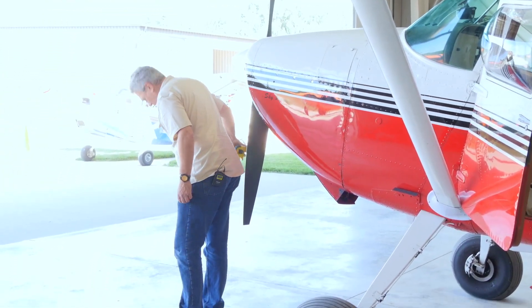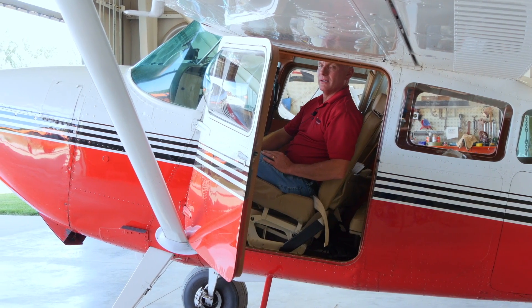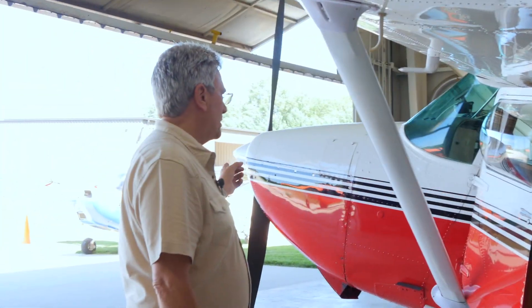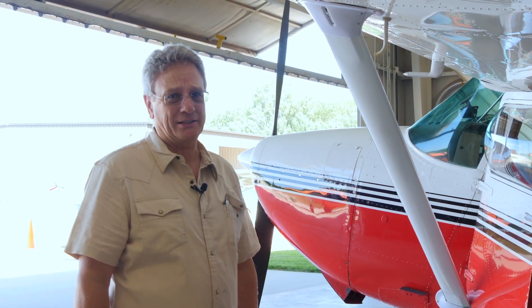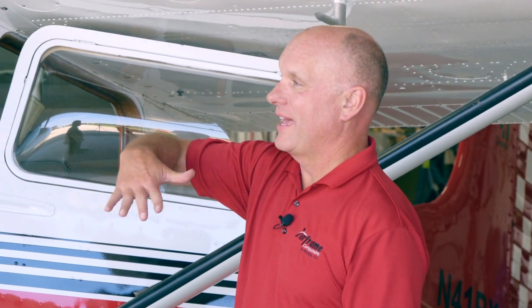Right now you have 21 inches of prop clearance, and this is also a seaplane prop with a big tail wheel, so a smaller tail wheel would give more prop clearance. And if we went to a three-blade prop, we'd have a smaller diameter with even more prop clearance — so to get a three-blade to hit the ground, it would be pitched over even further. Roy, it felt really uncomfortable with the tail that high in the air. It feels like you're looking straight down at the ground, yet very little difference in elevation in the cockpit translates into obviously a large height difference at the tail, but still plenty of clearance up at the front. And as Lee said, with a long prop and a big tail wheel that clearance is reduced, so with a smaller prop and smaller tail wheel, we'd have even more margin.